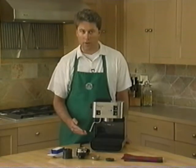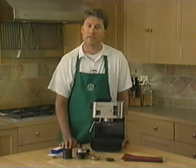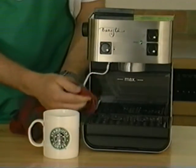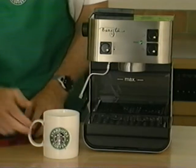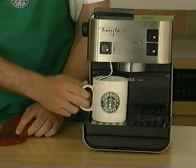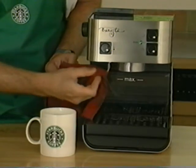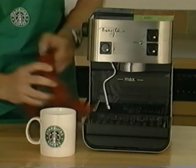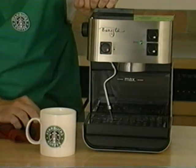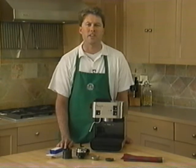Lastly, let's turn our attention to the steam wand. Because heating and steaming milk requires completely immersing the steam wand into the milk, many times the milk finds its way up into the steam wand, which can cause problems for the next time you wish to use the machine. Remember to clean the steam wand with a damp cloth immediately after each use. If you notice a residue buildup on the steam wand tip or if the water flowing through the steam wand appears to be restricted, submerge the steam wand into a tall container of hot water and allow it to soak overnight. When coming back to the machine, clean the steam wand with a damp cloth, then turn on the power and open up the steam wand — water will come through the wand, removing any milk residue inside. If the stream still seems restricted, with the machine unplugged, unfold a paper clip and carefully poke the bottom of the steam wand to see if any dried milk is still blocking the exit.